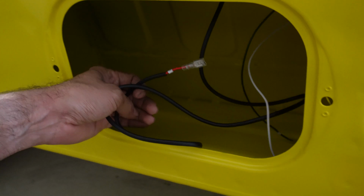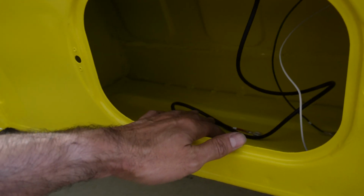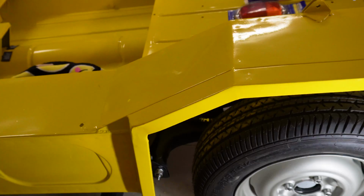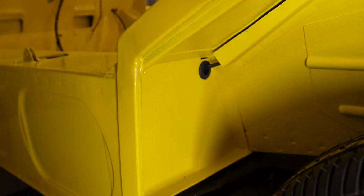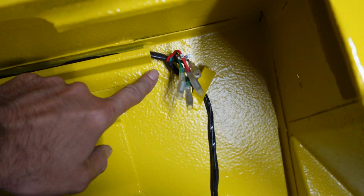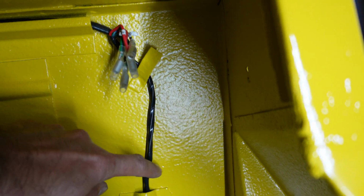So following along, there are wires in here if you want an additional fuel pump. I believe that gets bolted onto there. And then there's another wire for the fuel level sender. Then the cable continues. Where the fuel tank is, there's some metal clips above here, and they sort of hold that cable in place. Alright, the cable then makes its way to the rear of the car, so it goes through here. You've got to get it inside this metal tube and up here too, and then it comes out here. That bunch will stay there for the left-hand light, and then the cable continues.